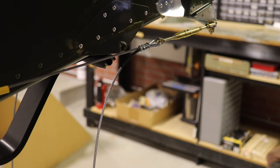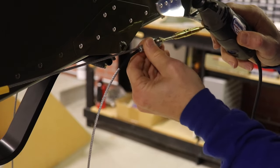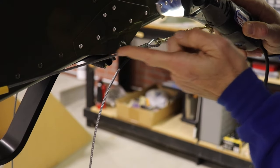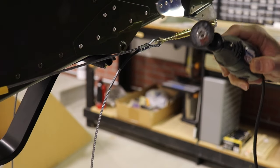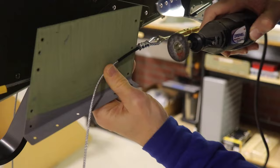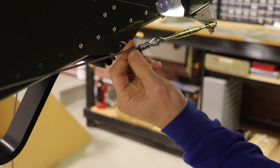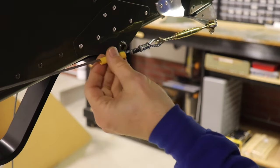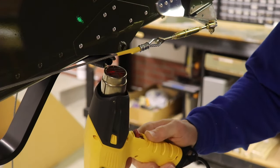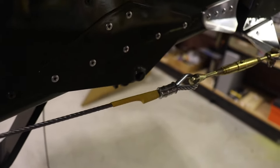I have a black piece of heat shrink tubing on the cable because when I cut the cable, that tubing keeps the ends from fraying. I'm going to use the Dremel to cut this, but I want to be very careful because if I even nick this cable it will completely ruin it. So I want to put a little guard in there so I don't hit it. Now you can see with the heat shrink on there the cable doesn't fray at all. I slide this one up here and shrink that one on. Now we have a nice finished rudder cable.